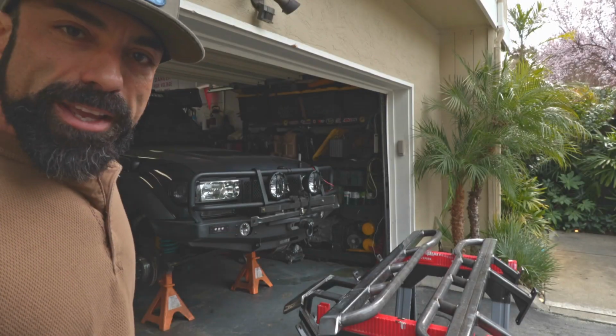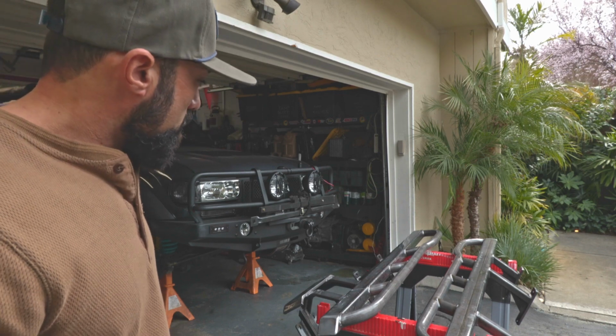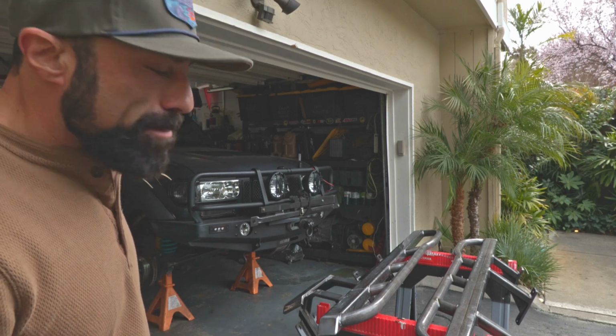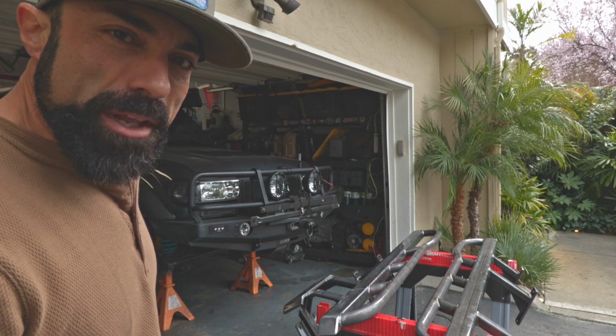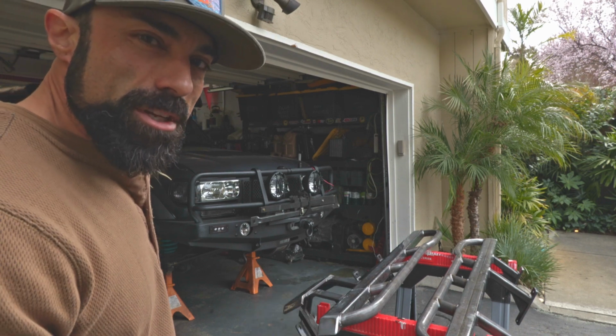We have the metal etching spray solution on the steel, and from this point on we just got to wait about 20 minutes. We got to make sure we keep the bare steel wet with solution. So if we see it drying out, we'll go ahead and reapply. So yeah, 20 minutes, we should be good to go.